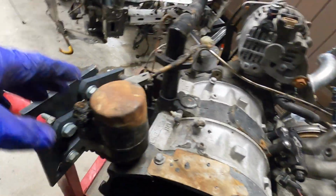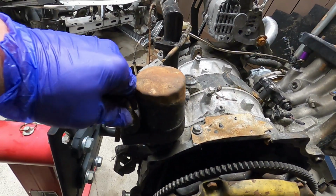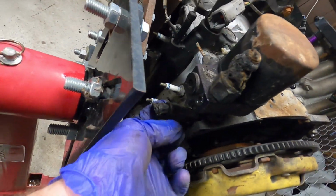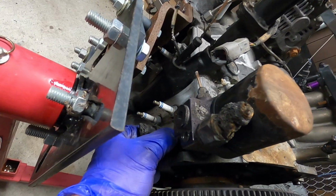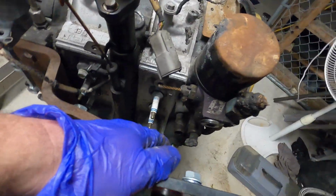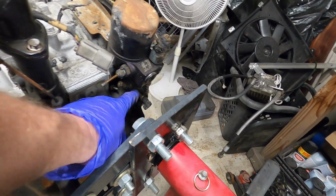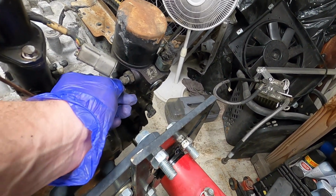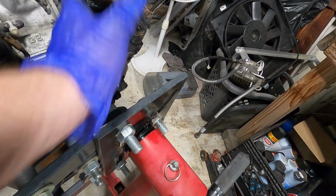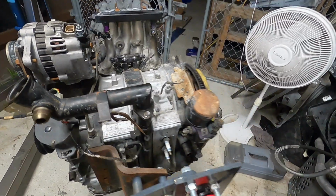And I mean, the oil filter's obviously fried. This is one of the sensors. That's not coming off, that's just the actual sensor body spinning. This sensor down here, so one of these is temp and one is pressure. This is pressure, I think. And oh no, that was an afterthought thing I was working on down there to try and make the stock gauges work. So that's just the stock location for the oil pressure sensor. It looks like pressure and temp, but this actual billet piece is fine, so we'll be able to reuse all that. And that's kind of the summary of the damage.